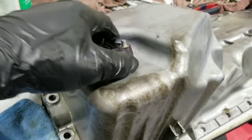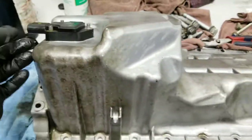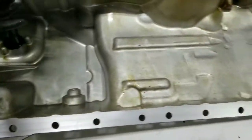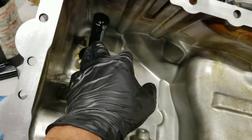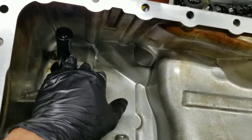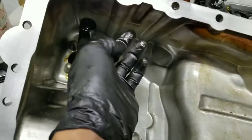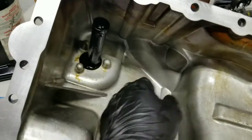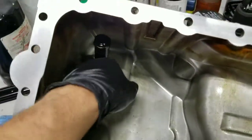We are also replacing the seal for the oil level sensor. These cars don't have a dipstick — this sensor right here is your oil level. The way it works is it warms up, and when it's hot, it measures the heat and temperature level of the oil. According to the temperature differential outside the sensor, it measures your oil level. There is an O-ring that goes in there, and we're going to be replacing that also while we're at it.